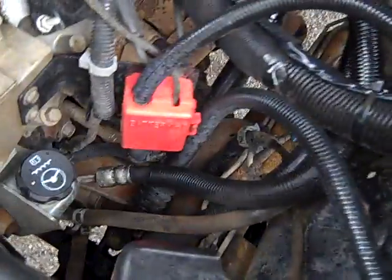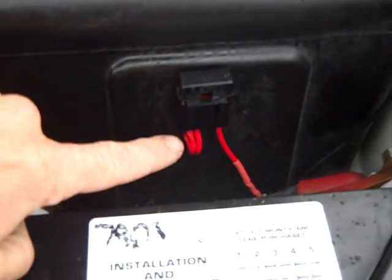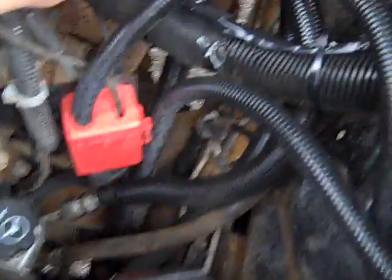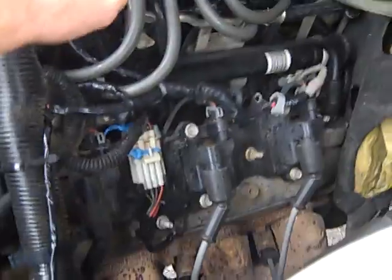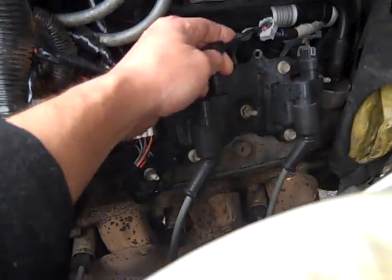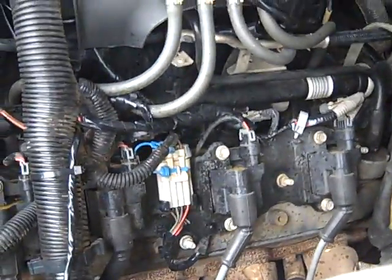What we did on one side of the block, we did to the other side. We run two wires for our power: one wire went to the ignition — I soldered down in there and tapped into the ignition source — and this is our permanent wire tapped into the battery. For the injectors, we actually piggyback off the factory injector. I cut back some of the insulation and solder into each individual injector. I prefer solder over just clipping in because it gives a cleaner install.